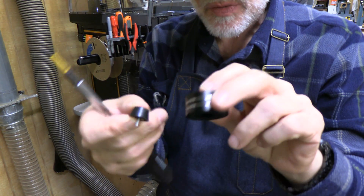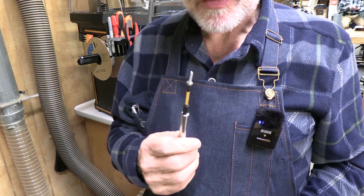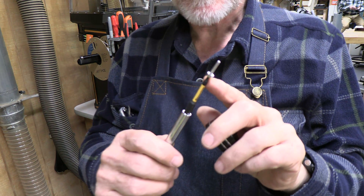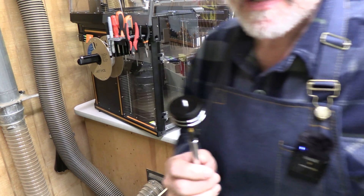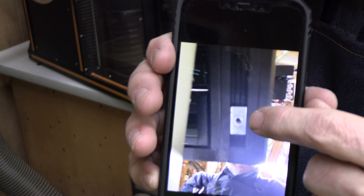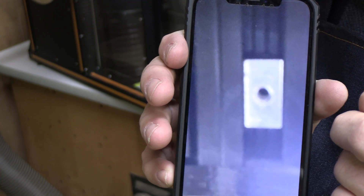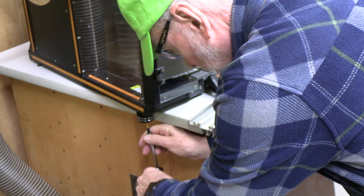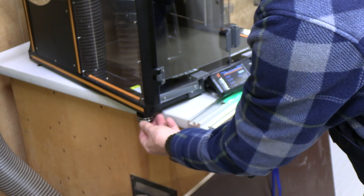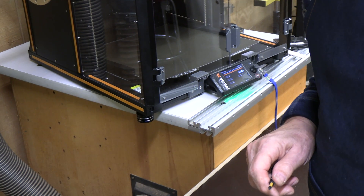And we're going to replace it with this, which is considerably bigger, with that nice O-ring. I changed the screw from a basic screw to one of these cap head screws — it takes the 2.5 millimeter screw. We're going to put it back in right now into this little insert with a threaded hole on the undersurface of the printer. There, I have it screwed in place. You can see it's a much nicer, larger diameter, and taller also. We'll do the other three now.